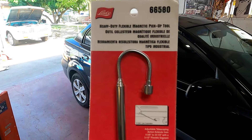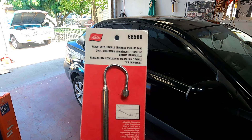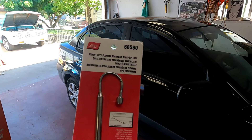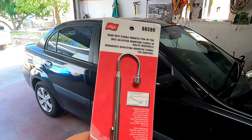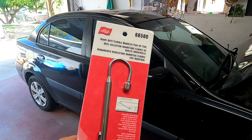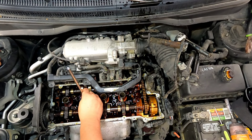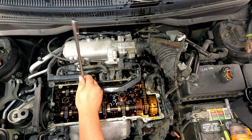So the plot thickens, but if we can get that piece out of there I'll feel very comfortable putting this back together. My main concern now is whether it nipped a valve. I went to O'Reilly's and found this little magnet here. Hopefully I can get it in there with a little hook shape down into the cylinder and search around and find that strap, so I know there's nothing jumping around making more damage.